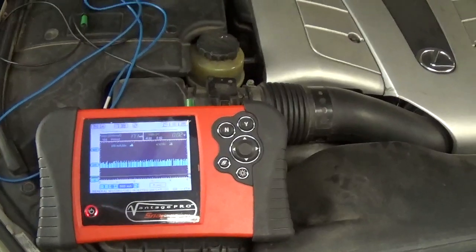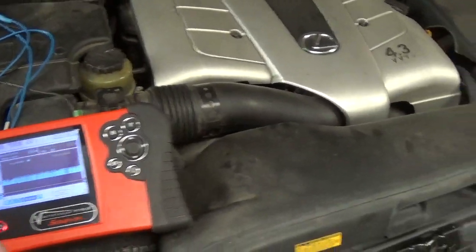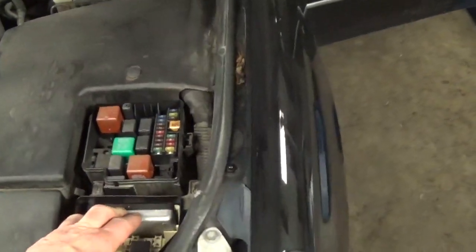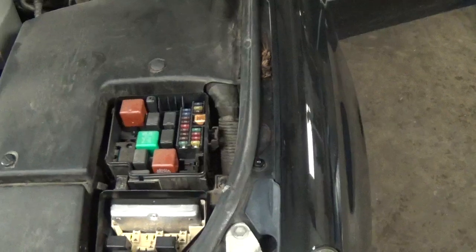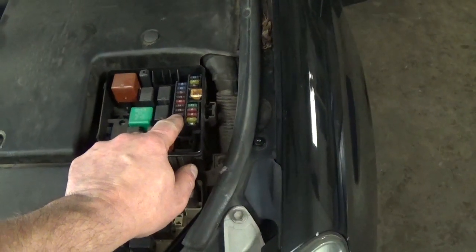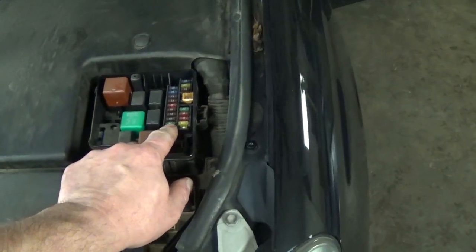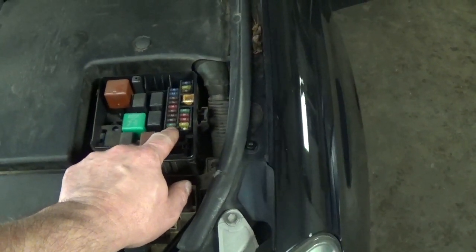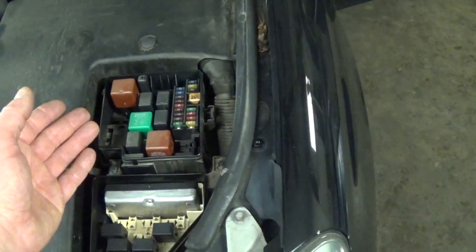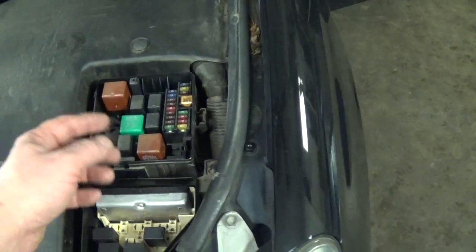And now I got my voltmeter and I started to check the voltage drop across my fuses. Basically, you put your meter to millivolts DC and you put your leads across these fuses and you're looking for the voltage drop. Now, there has to be absolute zero, it cannot be any voltage drop. When you're talking about the voltage drop, I'm sorry, you're talking about 1 or 2 millivolts. And it's supposed to be zero.